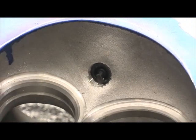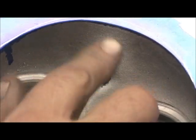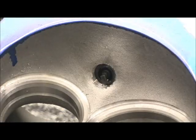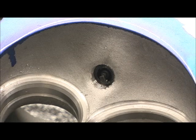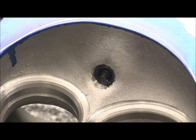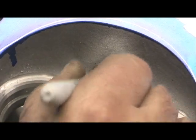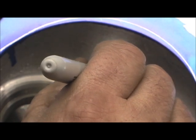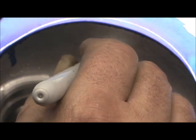Now, bringing it down in there, looks like I'm going to be able to play with the bottom. I don't have very much on the top, so it was fairly close to being what I want it to be. But what I'm going to do — and this is a tip for y'all — if you have something like that, I usually take a marker pen. I'm going to go in here and just color that black. Try to get some black on the thread right there and then mark out to the side. The reason I'm doing this is so I know where I'm going to be able to trim it and cut.